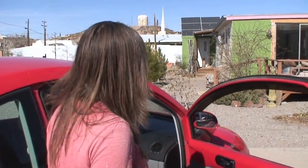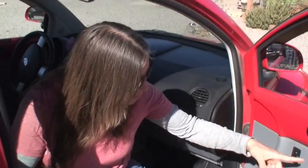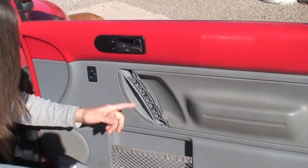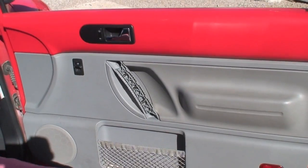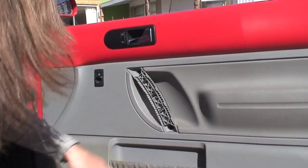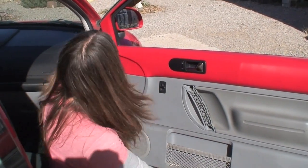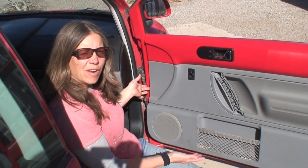All you need to do this repair is a screwdriver, maybe a magnet. I like to use a drill. I'm going to start by simply taking this door off in parts. I already loosened this by just prying it. This is off and I've got four bolts — two down here, two in here. Once the screws are out of the door, it's a panel, and there's some plastic tabs that you just kind of go pop, pop, pop.